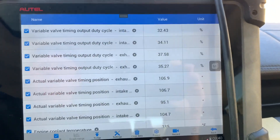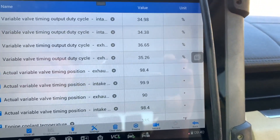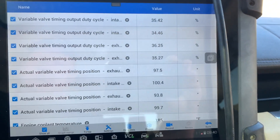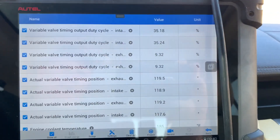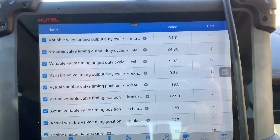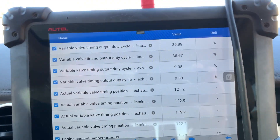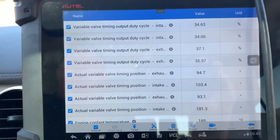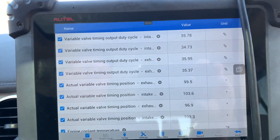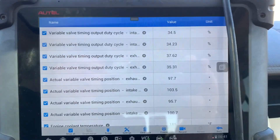I had to slow down for a car in front of me. As you can see, after it warms up, everything seems to work properly. That's why I'm thinking it's the variator - maybe the oil gets thinner when it warms up and everything moves better. It's hard to say, but that's kind of where I'm pointing to right now.